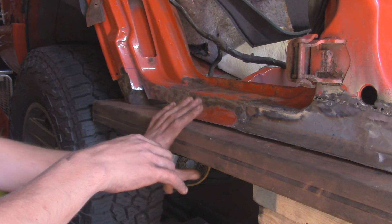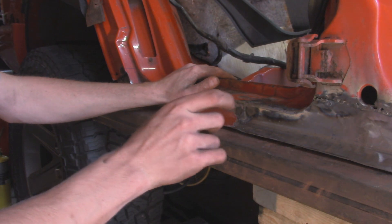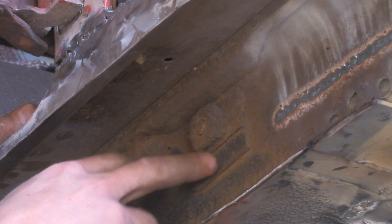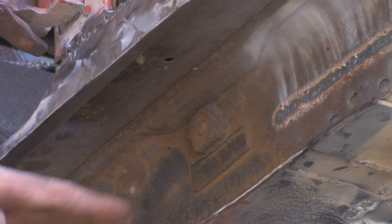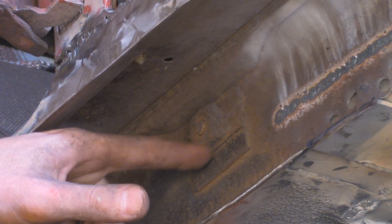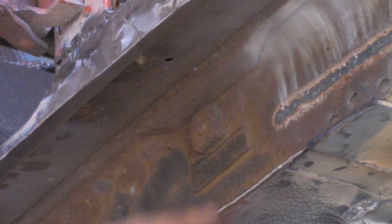Another thing is that this 2x6 piece of steel isn't all the way in. There is still a little bit of a gap — one from the new seat support that I made that I'm just going to have to cut off a little bit more. And then also the seat belt bolt — there's a welded nut on the inside of the rocker that we're going to have to shave off just a little bit to be able to fit this flush to the inside rocker. Now looking at the inside of the rocker, we got our passenger front lower seat bolt over here — it's actually a welded nut and there's a little bit of a plate here. We're going to have to just grind that off just a little bit, probably about a half inch. Basically we want a nice flat surface for our new rocker panel to slide up against on the inner rocker — so this is an obstruction that's going to cause some clearance issues. So we'll cut that out.